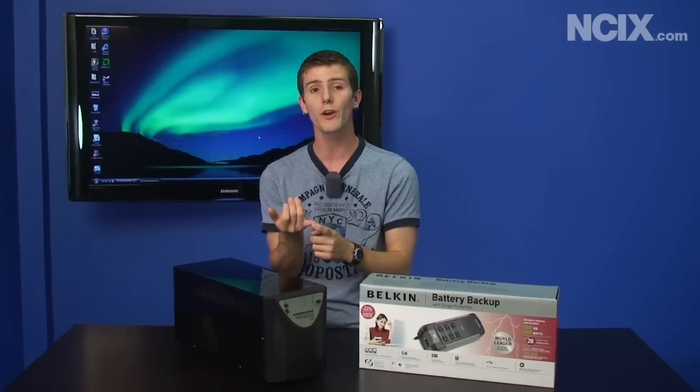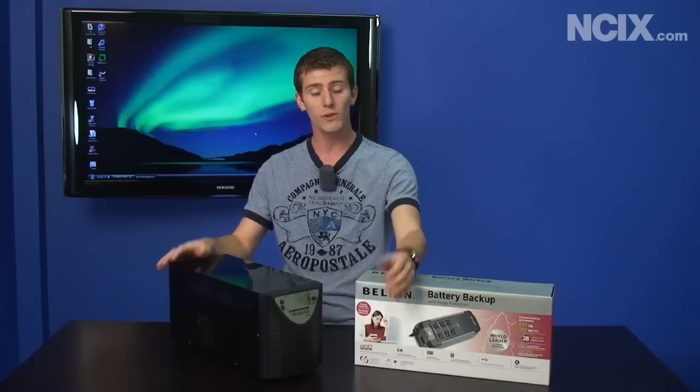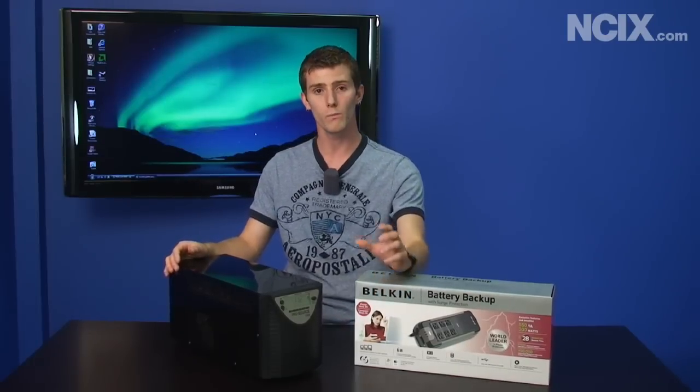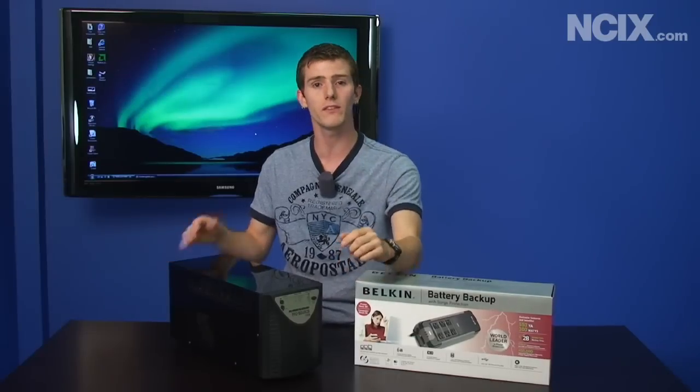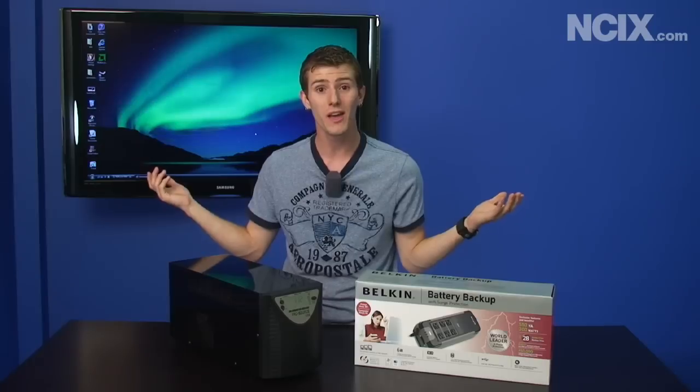So why are we talking about UPS's today? It's a fairly boring product, however I feel personally that it is very important and my personal experience has led me to believe it can even be essential. My parents live in a fairly new house built about a year and a half ago — they've got a media PC, a projector, all that stuff. Over the course of the last year I probably changed a dozen components: about three hard drives, four motherboards, a few different power supplies — I couldn't get it stable and the hardware just kept dying. Eventually I plugged in a UPS, and when a UPS kicks in you can hear a bit of a ticking noise, which means you've had some kind of brownout or voltage irregularity. It was happening every five minutes. I plugged in the UPS and it's been about six months — I haven't had a piece of hardware die in that computer since.